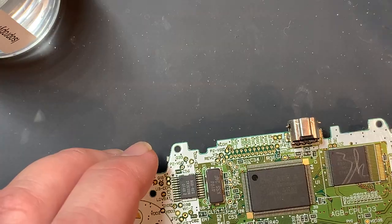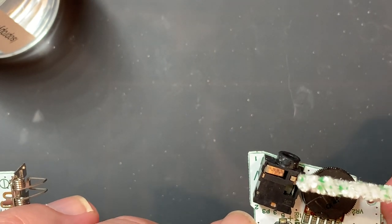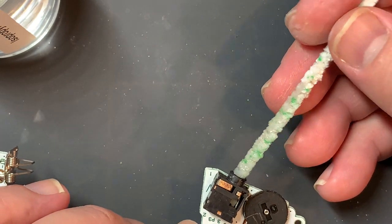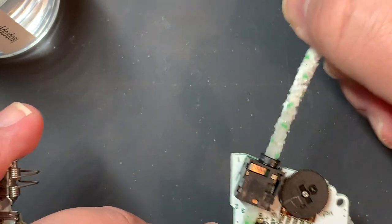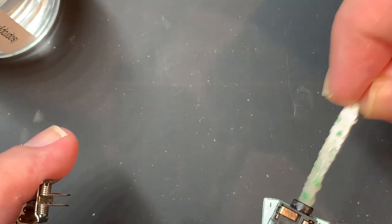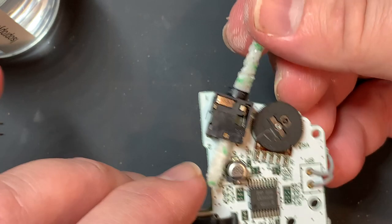One other thing - you can see the headphone jack has a little bit of rust to it, which could actually just be oxidation. What I do is take a pipe cleaner - I'll leave in the description where I get those - and dip it in isopropyl alcohol. This can go right through the jack. This pipe cleaner is not the same as arts and crafts pipe cleaners - this one is actually made for cleaning pipes, so I found it on Amazon. I kind of turn it as I go in and out, then put the dry side in there.